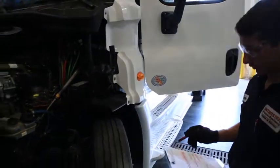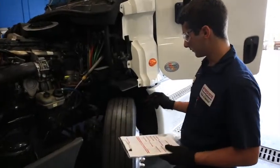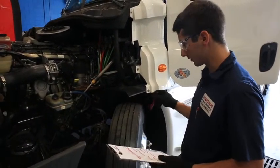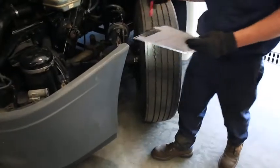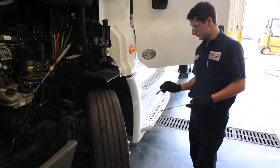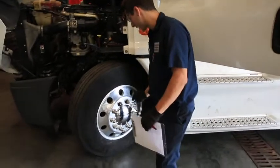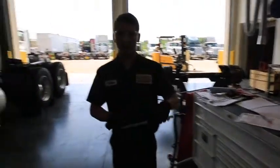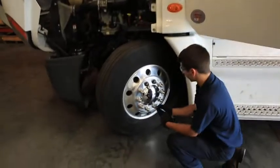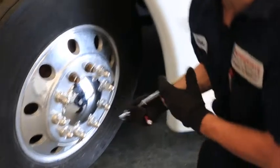When we get to the wheel, make sure there are no abrasions, bulges, or cuts on the outside, inside, and top of the tire. Look at the tread to make sure it's wearing flat and evenly for proper alignment, and check there are no illegal welds or cuts on the rim. Make sure all the lug nuts are tight and present — pop off all the caps and check for no shiny threads or rust trails indicating loose lug nuts. While we're there, check the air pressure in the tire using an air pressure gauge on every single tire, pressing firmly to read the pressure and verify it meets OEM specification.